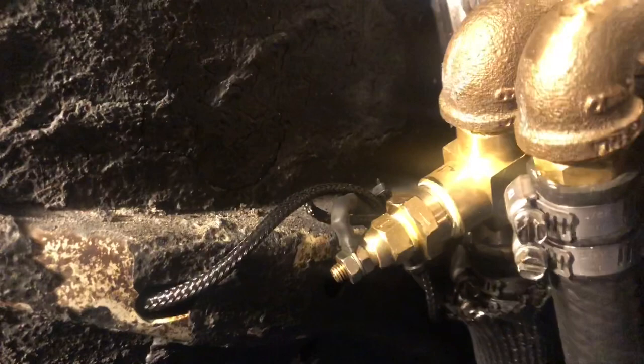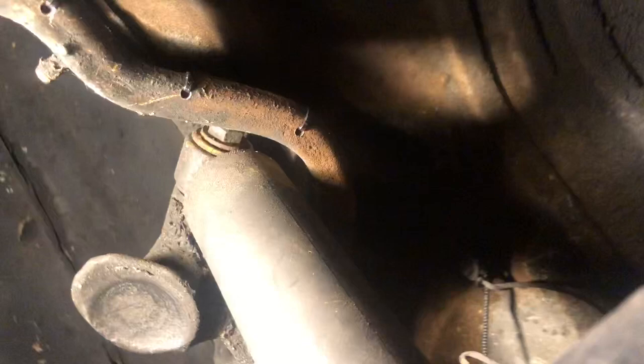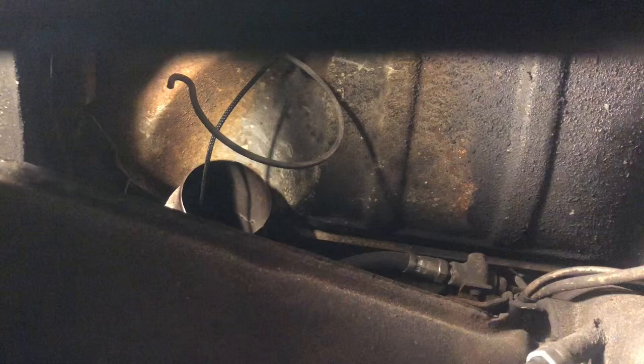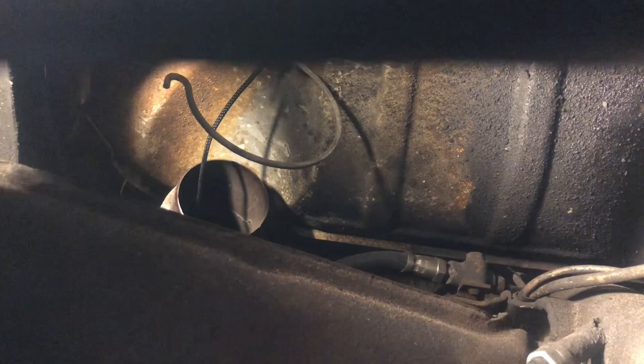So I have the light set up for us. Here's what we did — got the loom, got the sensor hooked up. I went ahead and wrapped probably two wraps of wire back there and zip-tied it out of the way, just so I have a little extra. It comes through that little piece right there and goes underneath. All I did is I ran it up along that channel, then I ran it in right there through where your heater would hook up. Now I'm not running a heater so it doesn't really matter. Then it comes out underneath the seat. Because the wire is in the loom, I don't have to worry about it getting chafed or punctured — it's really safe that way. So we'll go ahead and run the wire up front.